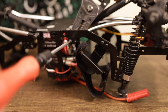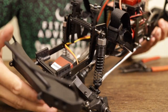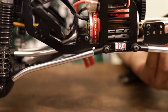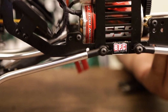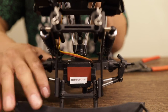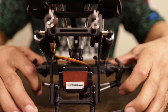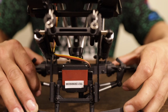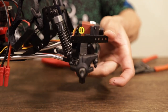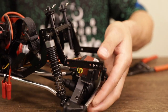After moving that all the way towards the front, you guys can kind of see the setup there and how it's supposed to be. You have three different mounting options, and I went ahead and left it in the center hole like the Red Cat came with. So after moving those linkages I got a lot more travel out of the front shocks. But it was fighting against itself once again because the servo mount was actually colliding with my bumper bracket and bumper mount itself. What I ended up having to do was remove my bumper mount. Now you guys can see all of that movement that is just wasted because of the bumper bracket — it's crazy. After you move those linkages, you open up a whole other world, but you can't use it because your bumper mount is in the way.